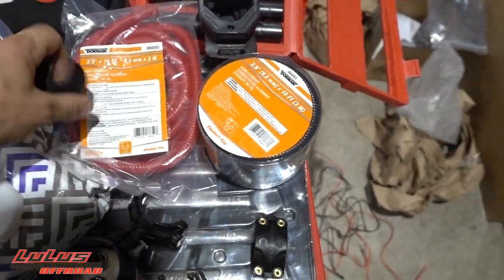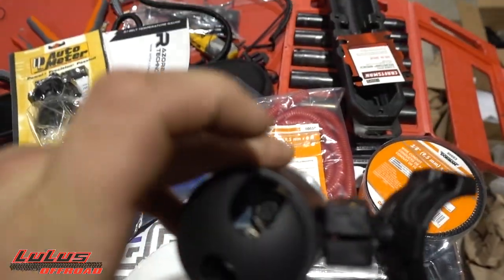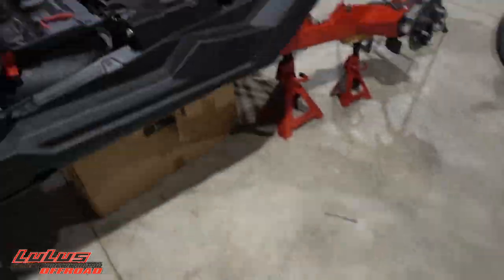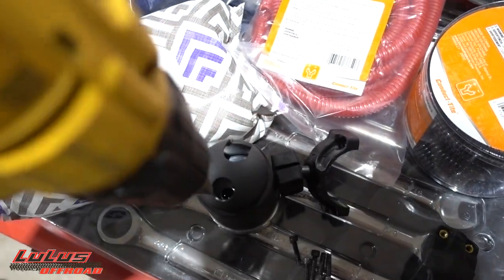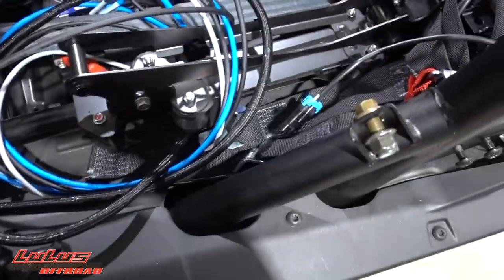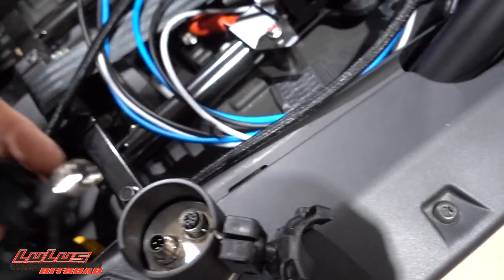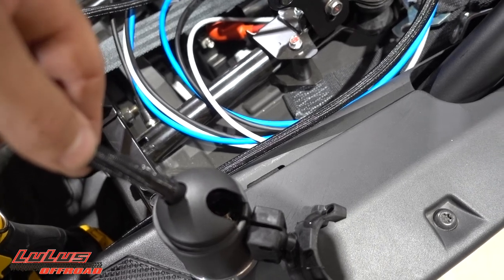Right now I'm making the mount for both cables. The cap that comes on the back of the roll pod has one cut-out on the side, but I need a second hole for the other wire. I grab the taper bit, got a good idea of placement, drilled the hole — it worked out perfect, perfectly lined up. You only need the hole just big enough for the wire to fit through. I'll pop the cap off, run the wire down, screw the gauge on, push the cap back on — nice clean professional finish.